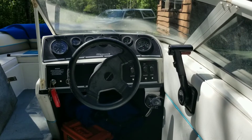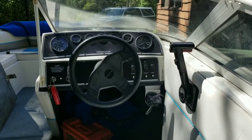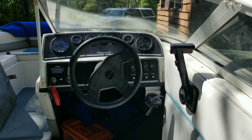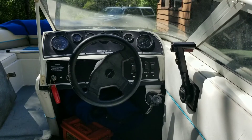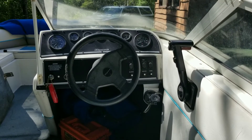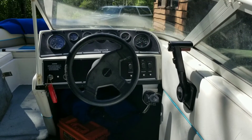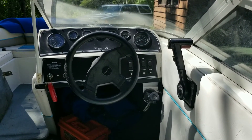It's still a little shaky, but that could also be my hand — I'm trying to hold the camera and the sending unit while leaning over the back seat, so it's not ideal. You can see from three-quarter tank to half tank it jumps quite quickly, though I can get it to stay in the middle range. There are definitely some contact issues, but it is reading more or less how I want it to. It's going to give me a good idea of fuel level and it's not going to leave me stranded anywhere.